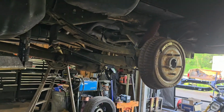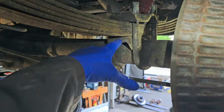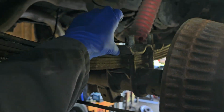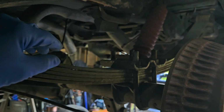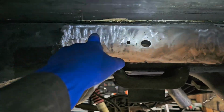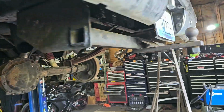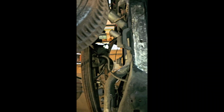And we got to flop the axle on top of the springs. And this kit actually comes with some of these, but they're made for the bottom side. Because when we do this, this is going to be riding on top of there with shorter shocks as well. So once we get that all flopped and once I get the bed up, I'll show you what we got going on. And then your notch, this makes it nice to plasma cut when everything's clean, and the best to weld as well. So there you go. Simple things, man, simple things. All right, back section, baby.